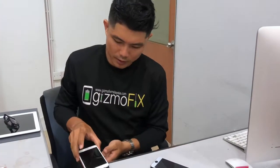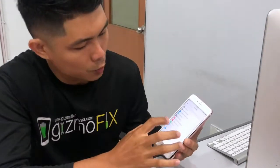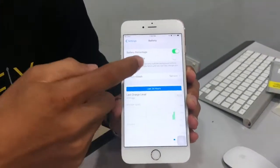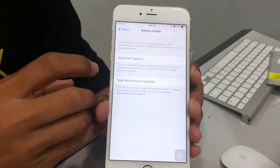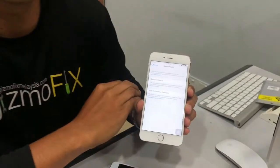On my right, this one is an iPhone 6s Plus. It was replaced with a non-original battery, or OEM battery. When you go into Settings and press Battery, it will show 'Service' here. We click inside, and under the maximum capacity, we have a dash — there's no reading for the non-original battery. So on iOS 12, we need to use an original battery. For those non-original OEM batteries you put in, the battery health cannot be read.